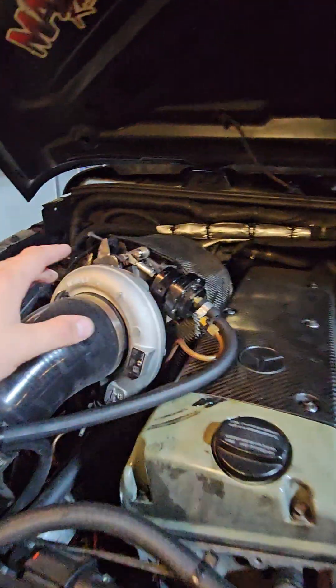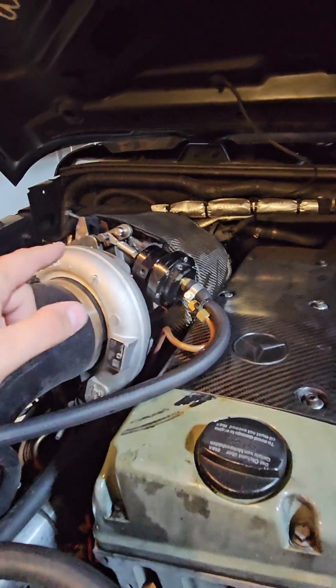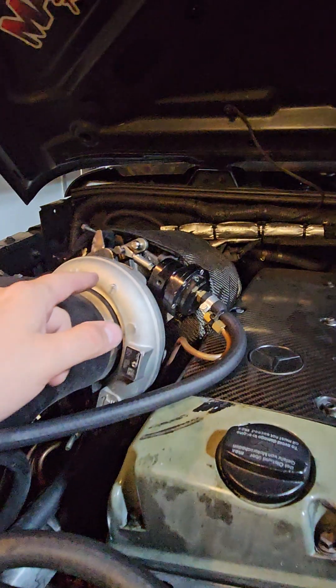I'll give you a preview of the tags since no one ever does that — it is the 05Y, or 050AJ housing. You can identify these with '050Y' or similar markings. Unfortunately it was a little damaged — it was dropped in shipping, so I had to weld the housing together. In my opinion this exhaust housing is massive; it's meant for a nine-liter tractor engine, not a three-liter engine, so it's a little laggy.